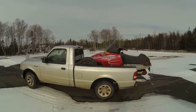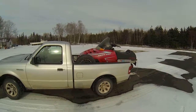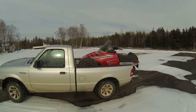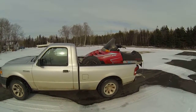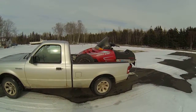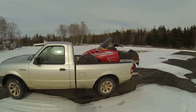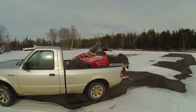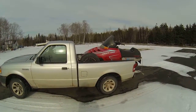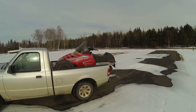Anyway, I decided to make a little video about it. I don't think it's anything too serious. I stuck my finger down the cylinder head — it's a 440 liquid-cooled 94 model — and it seems to have good compression, so it shouldn't be a piston. The seals should be good too, because if a crank seal went you'd lose compression. I replaced the coil a few years ago, so I'm thinking it could be the coil again.